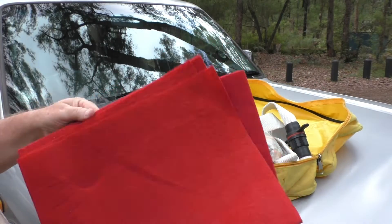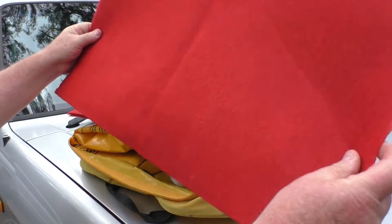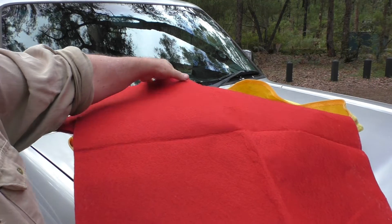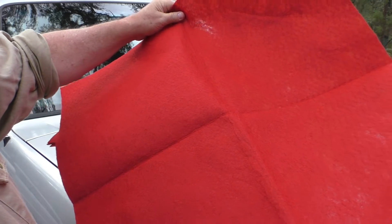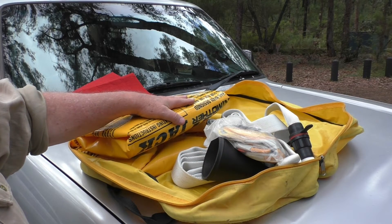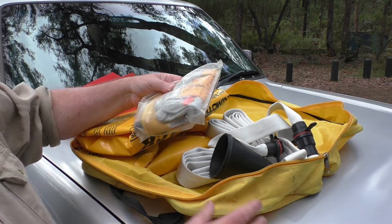Initially you've got some padding here that helps protect the bag — you put one on the top and one on the bottom, just a bit of extra insurance against getting a puncture. These ones will take up to four tonnes, and with a four wheel drive you're probably going to have pretty close to three tonnes on there, so you don't want anything getting in and damaging it, otherwise you're going to have a pretty sharp deflation.